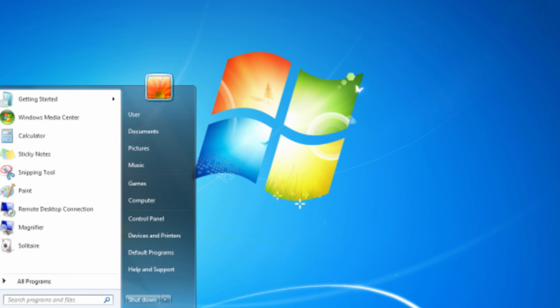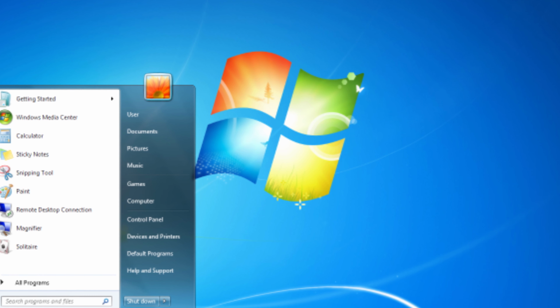And for the OS, I'm going for good old Windows 7 32-bit. Why? Well, the main reason is actually because I can't get the drivers for the Quadro 2000 graphics card to work on any OS newer than Windows 7. Plus, the side benefit of this is that Windows 7 should require fewer resources to run than Windows 10, which also should give us a nice little boost in performance. And I'm very curious to see what the experience is going to be like on this.